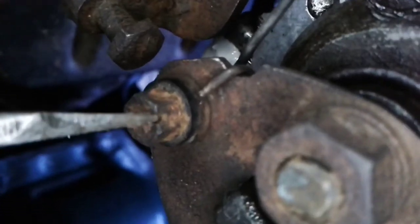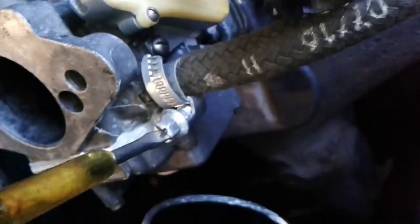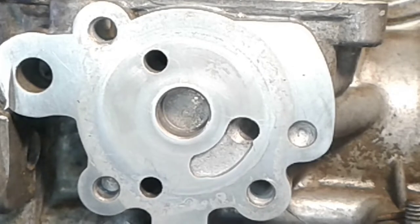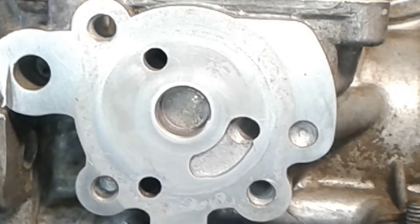Nuts are also half-inch size. There is a brass plate on which the carburetor number is stamped. This carburetor worked alongside another carburetor. The throttle cable clip can be used from other Volvo models. Disconnect the cable and tubes and lift out the carburetor. Starting devices are different.